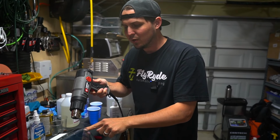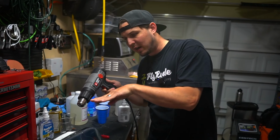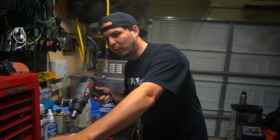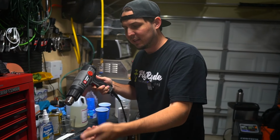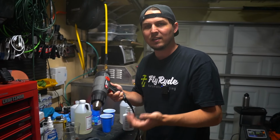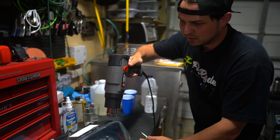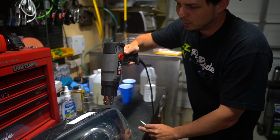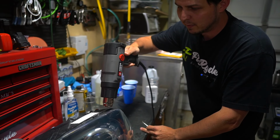And that means that there's no easy way of removing the lens without actually putting a screwdriver in and kind of prying it away from the clear plastic on here. And then after that, we have to go back through the headlight and remove all of the original sealant so that we can have it prepared and ready for the good rubber butyl. The other thing too is you don't want to overheat stuff. That's why opening lights with a heat gun, especially Permasealed, like you're begging for damage for sure.